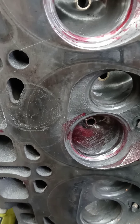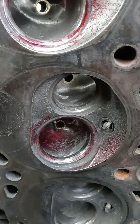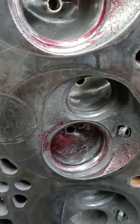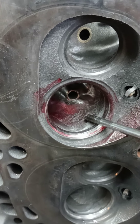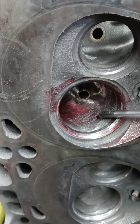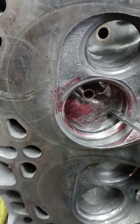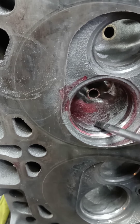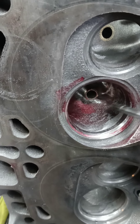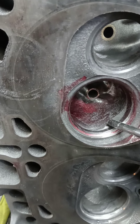I'm not building a flat-out race car, but I have a problem — if I think something can be better, I have to do it. I actually thought this bowl being made like this might actually help. My theory was that if the fuel is running up to the top, this lip bean here would actually help that fuel break up or atomize. I was kind of afraid to actually take that casting off.